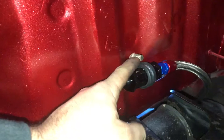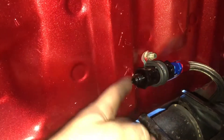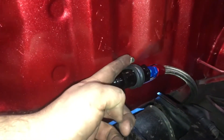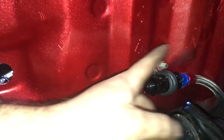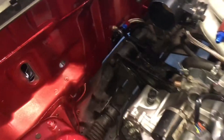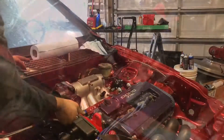I have it mounted on the wall right now. What I didn't realize is that this is a low spot where the stud was coming out of, so what I think I'll end up doing is going to the parts store and getting a longer stud or a longer bolt so I can bring it outwards, have it hanging off of the wall a little bit. So this will extend out to about right there, and that way I can have this about half an inch to an inch away from the firewall — it won't be dependent on this being squeezed together. I'm going to go ahead and cut the AN line right now, measure this out, and see how much exactly I need.